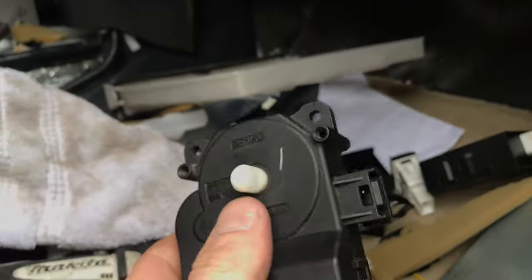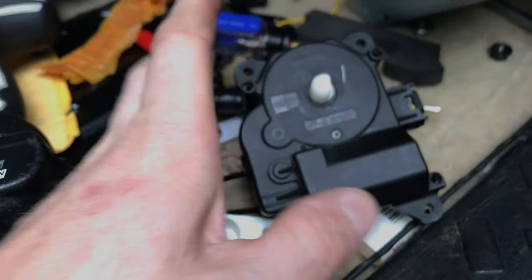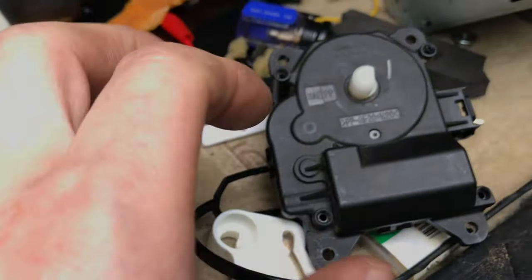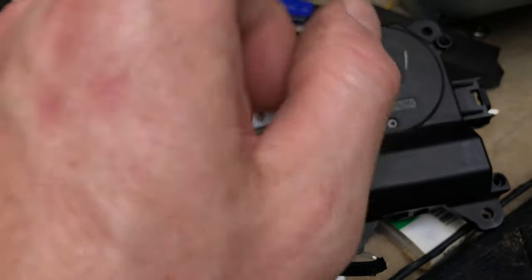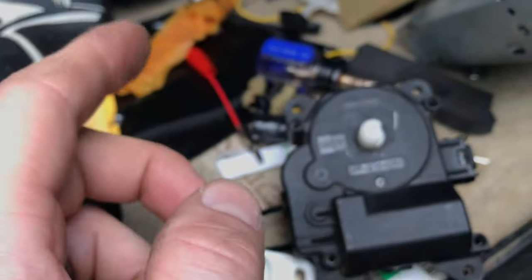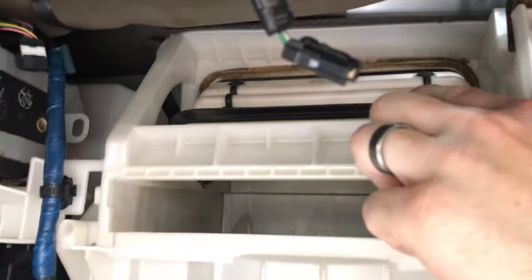I did take the snaps, gently pry them and pull this off. Inside there's a motor — the shaft goes this way and transfers to a gear that spins the other way, from a small gear to a slightly bigger one and then to a large one. If you take this cover off, you can pull that gear up and move it a small amount. What I would do on the other servo is move the gear a few teeth over until the end looks like this position, snap it back down, and you still have the full range of motion forward and backward — just offset a little to match the other servo. That would solve the problem of it not fully closing.